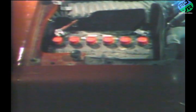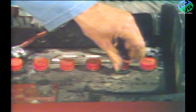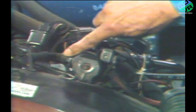When you are faced with a problem of a dead or weak battery, and you want to quickly find which part or assembly of the system is causing the trouble, first, verify the complaint. Once you have convinced yourself that problems do exist, give the system a thorough visual inspection. Is the battery case solid and filled properly, or is it low on fluid, or maybe cracked or drained of all fluid? Are the connections at the starting motor and the relay clean and tight?